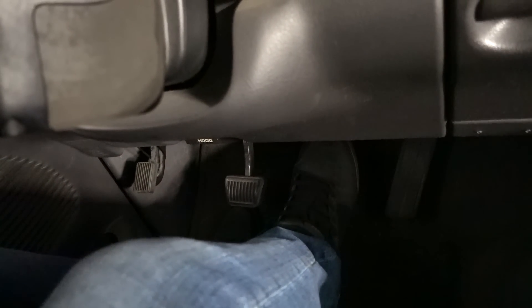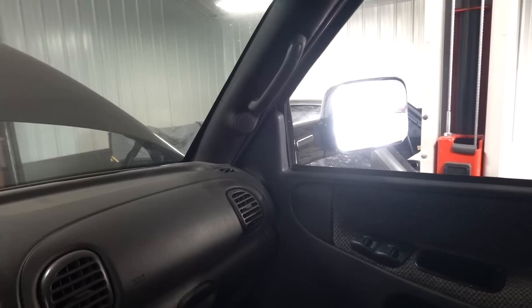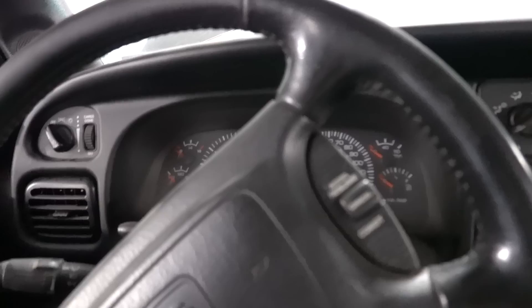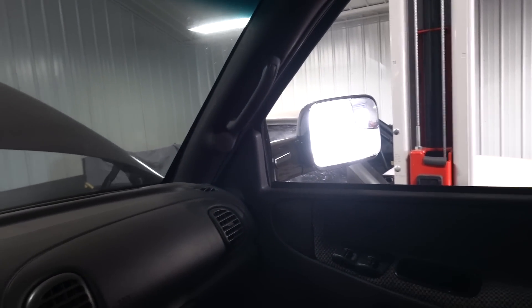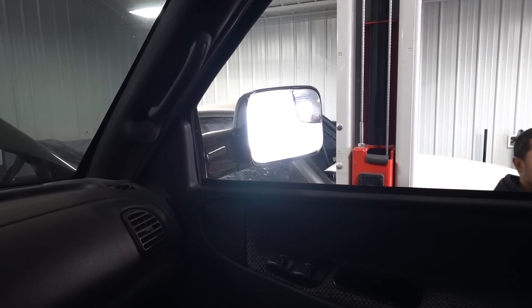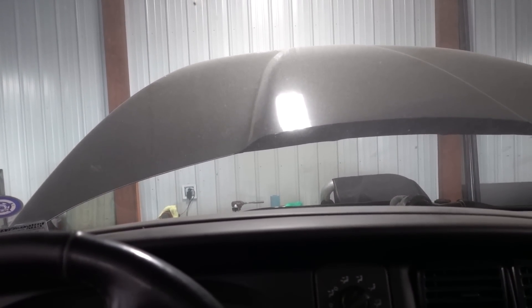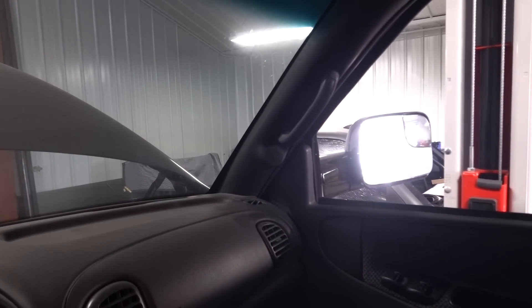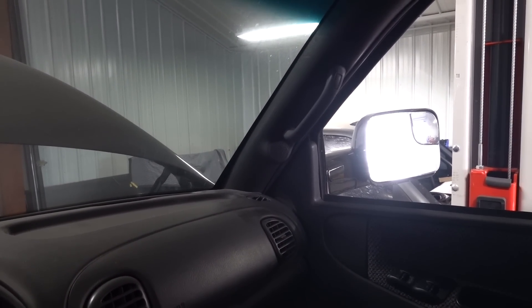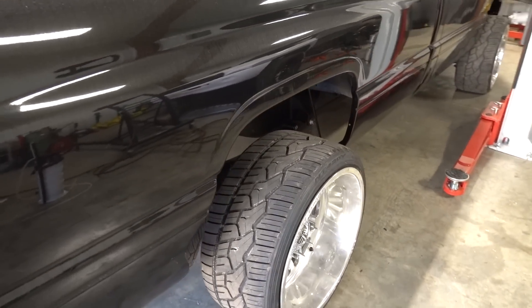Tell me when to pump, Jimmy. Pump. It doesn't even feel that bad right now. Hey Jimmy, have you ever had to bleed brakes by yourself? How would you do that? Call an Uber — I just need your foot three or four times. Nice, smooth, big pushes and don't let it touch the floor. Not fast — slow, smooth big pushes. Slow pumps win the race. Holding — all right.